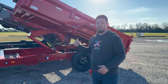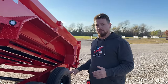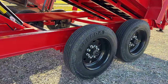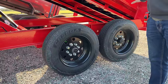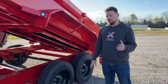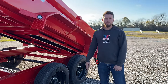With the cylinder and placement of our scissor, we make sure this trailer will lift every bit of its stated carrying capacity. The DJX comes standard with two 7,000 pound Lippert electric brake axles with 16 inch wheels and 10 ply tires. This trailer has been upgraded to two 8,000 pound electric brake axles — when you order with the 8,000 pound axles you get 17.5 inch wheels and 16 ply tires standard. We also chose grease for the axle bearings, because if you crack the cap you won't lose your grease like you would with oil, and it's a lot easier to work with for maintenance.